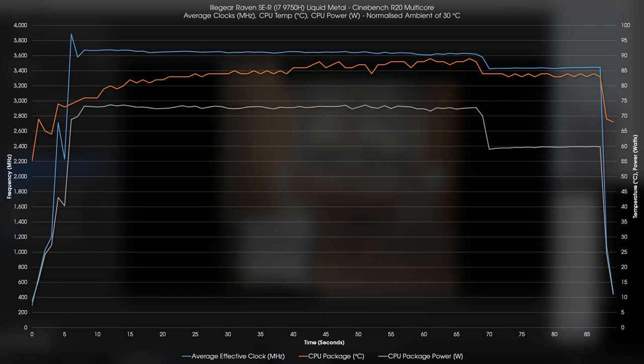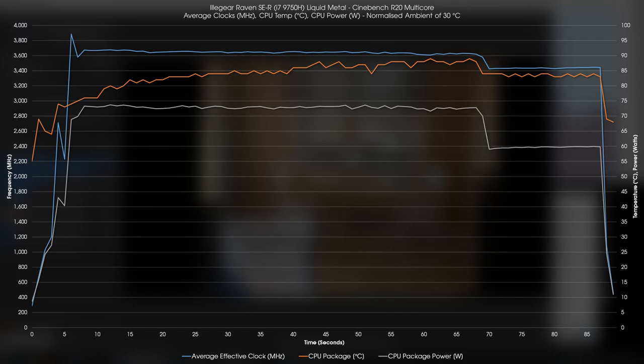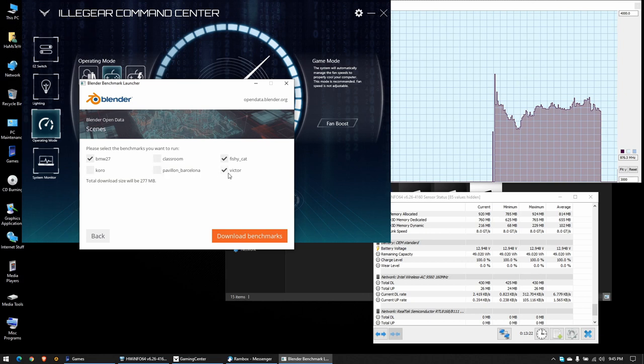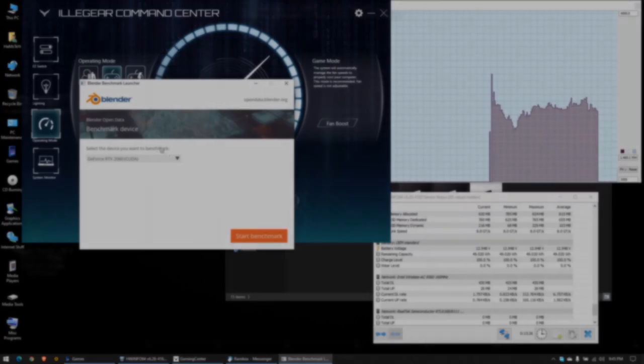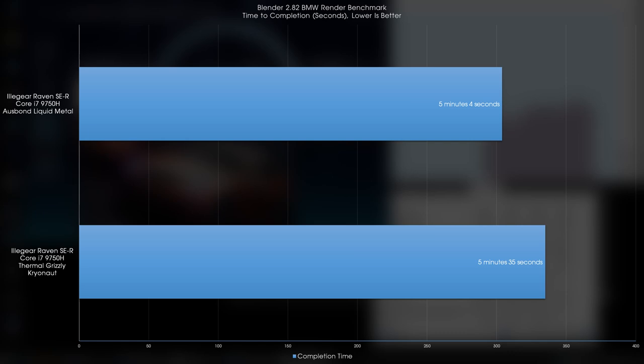This is very evident in the first graph where the CPU ran at roughly 73 watts for one minute, around 3.65 gigahertz, hitting that maximum of 89 Celsius, before settling at 60 watts and running at 3.45 gigahertz, with temperature never exceeding 84 Celsius for the rest of the benchmark. If random numbers don't mean anything to you, how about time instead? In the Blender BMW benchmark run, the liquid metal laptop ran 30 seconds faster and didn't overheat or thermal throttle at all — unlike before. So if you have a render-heavy workflow and you're running 2, 3, 10, 20 or more render passes, you're going to start saving a lot of time and maybe even get an extra lunch break.